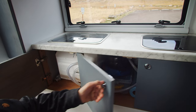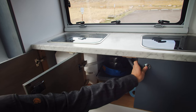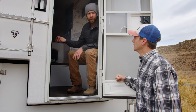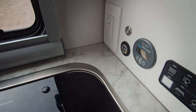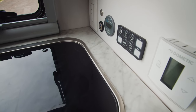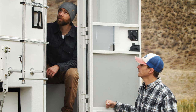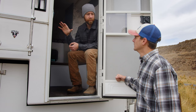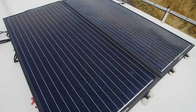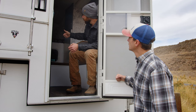Below the sink there's storage and a lot of piping — propane lines, water lines. Up above, there's cabinetry with an under-cabinet light, a 110 plug, a 12-volt plug, a remote for the fan, a thermometer, the thermostat for the furnace, a Switch Pro to control the lights and water pump, and a battery monitor that monitors the batteries and solar panels. There's also a water heater switch — flip it and the water heater ignites and heats water in a few minutes.